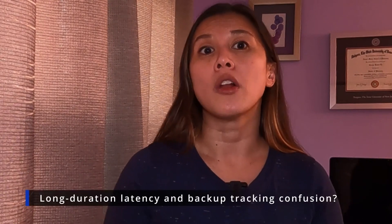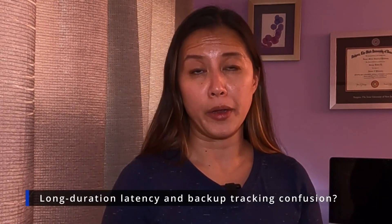In regards to wireless systems, this is not just for the Rode Wireless Go 2 — this is for all wireless microphone systems that use the 2.4 gigahertz connection. You're going to start experiencing some latencies the longer you record video and audio, closer to the 10-minute mark or past. One of the things I struggle with on the Rode Wireless Go 2 is related to the backup recording feature. I don't have a way to disable or temporarily turn off the backup recording while I stop the video recording on my GoPro and take a break.